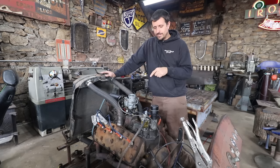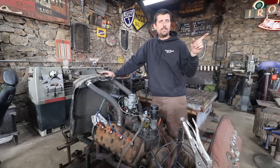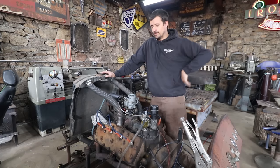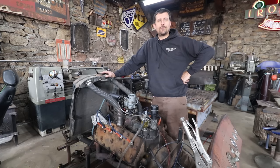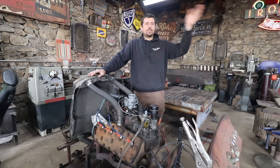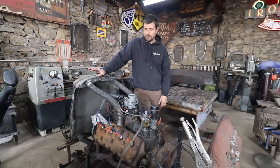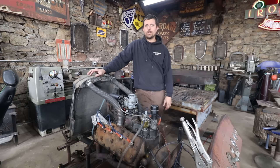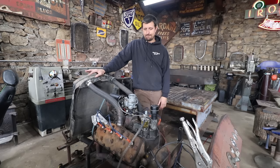So pull this intake off. We're gonna stick my aluminum intake with the dual 97s on it and try and get it running better. The mixture screws on this one, Matt and Steve were fiddling around with, they're off a little bit. So instead of spending the time to get this one right, we're just gonna put my two 97s that Steve rebuilt on and get it running on that and fill this with water and get it to run for 20 or so minutes. So a little bit of work to do and then we'll be back at it.